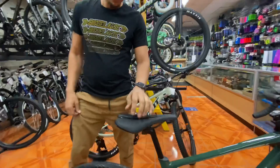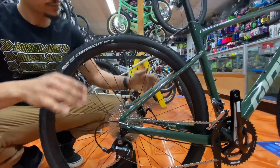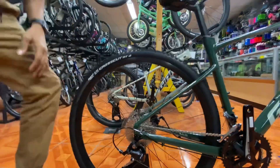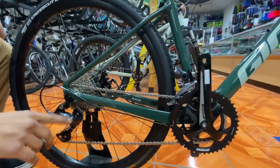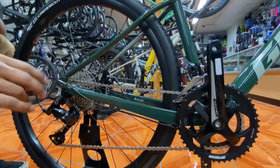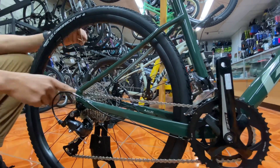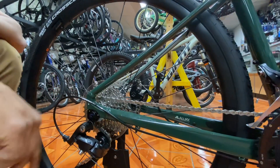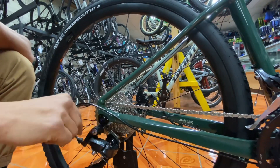Going to the back — same tire, same rim, same mechanical disc brake with the 160mm rotor. You do have the nine-speed drivetrain on here, so it's a Sora component. Sora is about mid-level — decent, not anything high-end, not too basic either. On the back you have an 11-34 cassette, which is a pretty big spread.